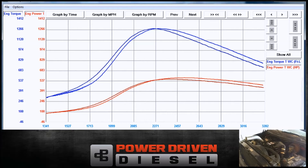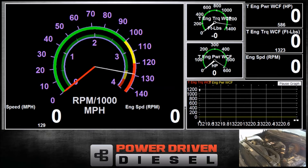Now we're going to do a test with the 5,000 pound load to see how quickly it responds, and we'll overlay that with the 62 as well so we can get a real direct comparison. Again, the only difference in these is the compressor wheel — that's it. So we'll see what kind of power difference that makes.